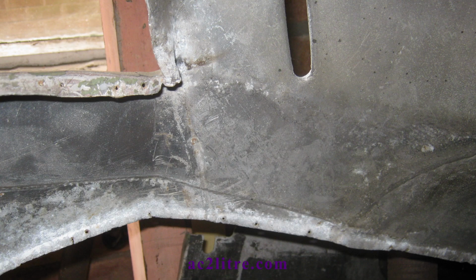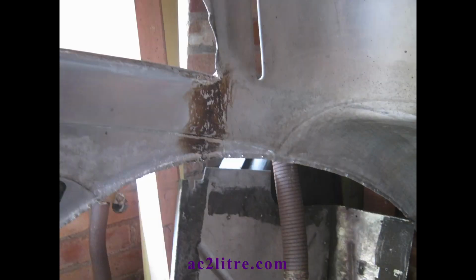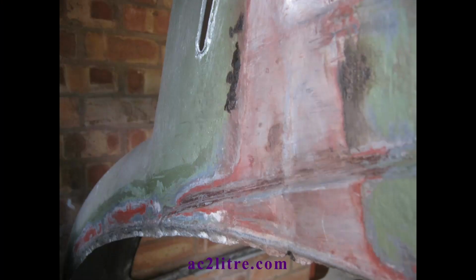There were a few dents and creases to straighten out. I annealed 2 of those. Annealing aluminium is tricky because the metal does not change colour, so there is a risk of melting it. An old technique I vaguely recalled was to apply soap to the metal and heat it until the soap turns black. I wondered if there was a more precise method and found all sorts of people supplying special heat-sensitive crayons.